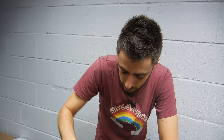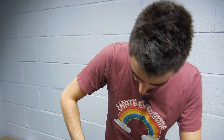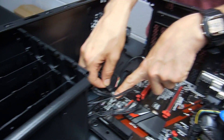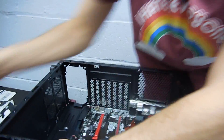Reset can go either way as it's just a short, but the power LED needs to be in the right position. Once that's done I like to put a little cable tie to secure things so they won't move. HD audio is always pretty much at the bottom of the motherboard. The USB plug goes where the big USB label is — everything goes in only one way, so if you're forcing it, it's probably the wrong way around. The fan here has three pins and the header has four — it doesn't really matter, just use the first three.